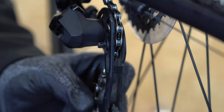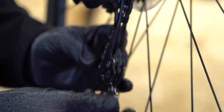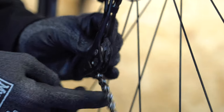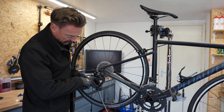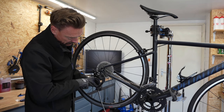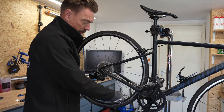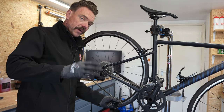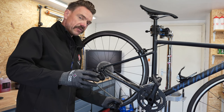Similarly, when you come to the bottom pulley wheel, make sure you don't accidentally go around the outside of the whole derailleur, because there's another tab joining the two parts there. So get inside it — it's around, inside, around, inside. At this point now, this is where we're going to determine how long that chain should be.